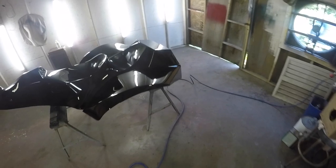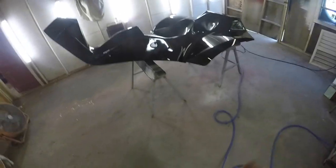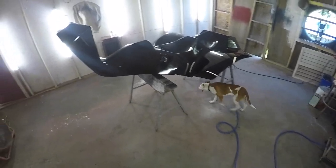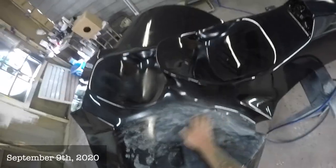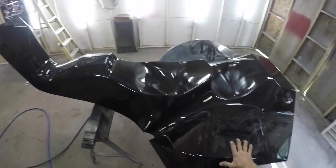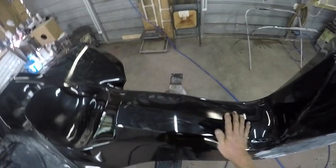We've just wiped it down, going to get the fan out, tack cloth it, and then get ready to lay down the black base coat - two coats of clear, get tacky, and lay jet-black metal flake down 0.008 with a 1.8mm tip on the paint gun. We've got two coats of clear on it - it still looks rough because we're going to wet sand all this down, then come back with the metal flake mixed with clear, put that down and bury it. Let it sit for another day, wet sand it down again, lay three or four more coats, and it's done. It was really hot that day and the clear dry-sprayed, but I've got to sand all this down anyway before putting the glitter - the metal flake - on.